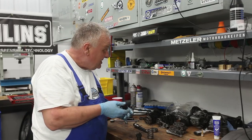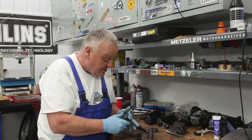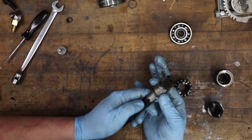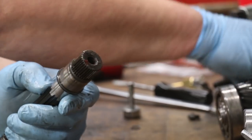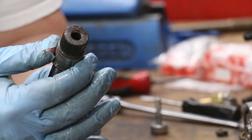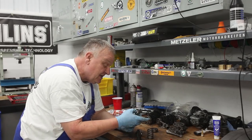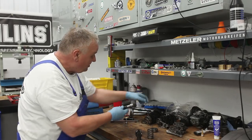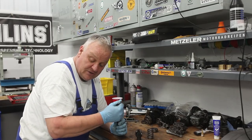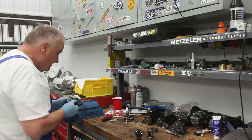Looking at the input shaft gear — there are a couple of different versions. Later models have an X on them and I believe have 17.5-degree teeth; the earlier versions were 15 degrees. It's important to look at what gears you have if you're going to change any. Whether it has an X or not is a big thing to consider — there's information about that on our website. The last part here is the inner race of the bearing, which is pressed on the shaft. We need to get it off, and I'm going to use the press since it's a whole lot easier.